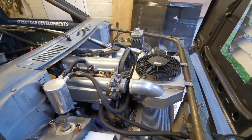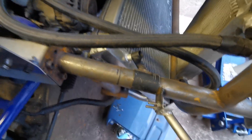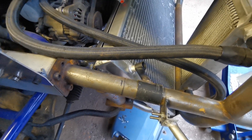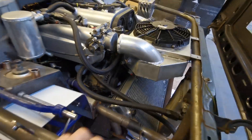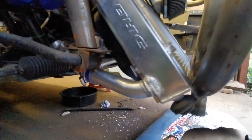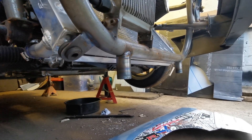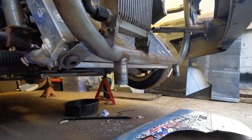I've got cowlings done for the fans down there. I actually remounted the radiator because I wanted a bit more space — once I got the cowlings on there, there wasn't actually enough space to change the alternator belt if I needed to. So I remade that mount. I also put some rubber doughnut mounts at the bottom so the radiator is slightly lower and not quite as tilted back. I also put on these mounts down here which need fully welding, but I'll do that once the tube front comes off — that's for the front splitter and stuff to mount to.